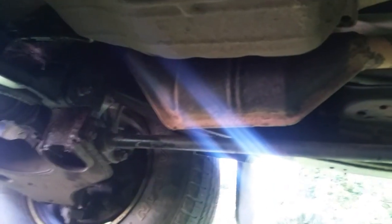Now I can get to that exhaust right there — I can cut those bolts out. You can see a lot of room over there. It would be beautiful if it would just slide right out. I just got my jack here holding up the transmission. On this side I've got lots of room now. I think this side will slide right down. But I'll have to come over here and get these bolts cut off. There's this little bracket that kind of goes over, so I'm going to try to figure out a way to get this out.